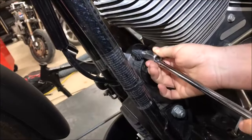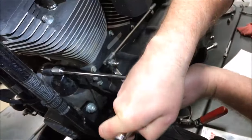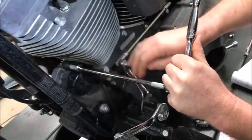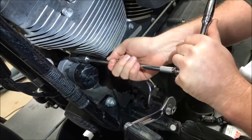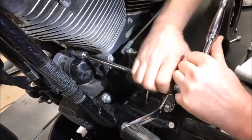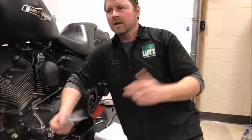I'll use a long extension and try to grab as much real estate as I can. Watch here — I'm intentionally pushing this back, and now it's going to crush that filter and take it right off. I'll go ahead and start moving, then just reset. That thing will grab onto a super stuck oil filter and get it right off. You can also use this for installing, because now that they put that nut on oil filters, there's a torque spec.